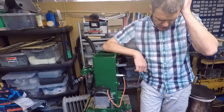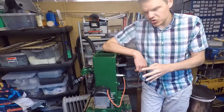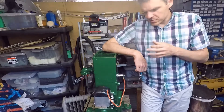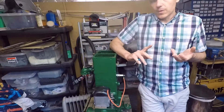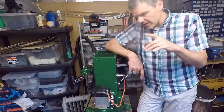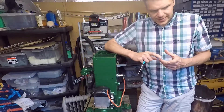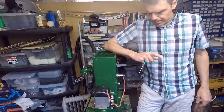On this particular occasion, remember that in a previous video I had to find top dead center with a dial test indicator because my flywheel hasn't got a mark for top dead center — so I needed to make my own mark. That also turned out to be quite useful for setting up the mag.